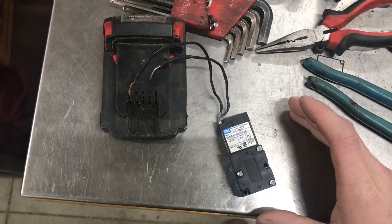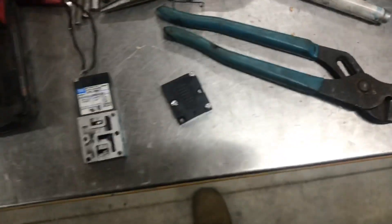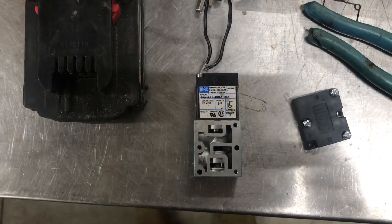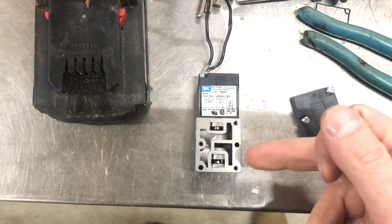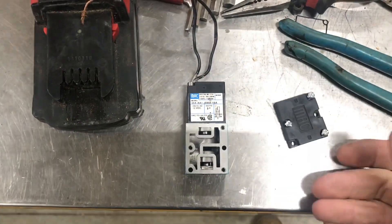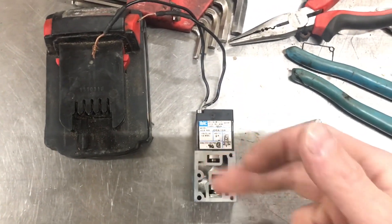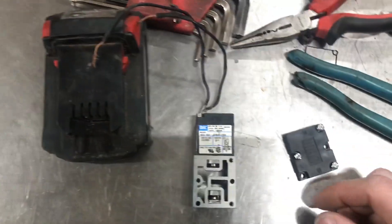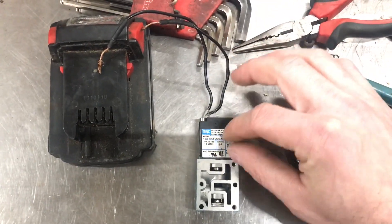This is actually a good sensor, but unfortunately I destroyed it just for you guys. I had another one in the garage — in fact, I have a three-port boost control solenoid in here as well. To reiterate: you're going to do your flow test and make sure air is flowing in the in-port through the B-port a little bit. Then you can hook this up to power and apply air — air should be flowing to the top port A. Once that is confirmed as good, hook this up to a power source and turn it on and off to make sure that this electromagnet is cycling.